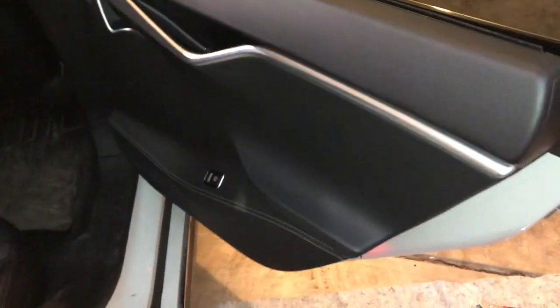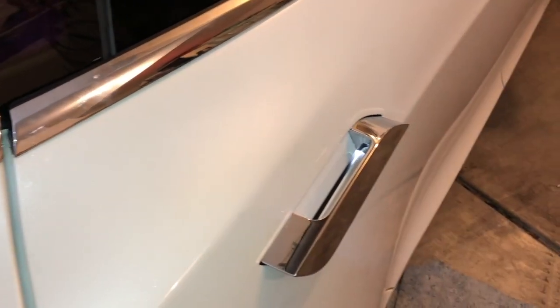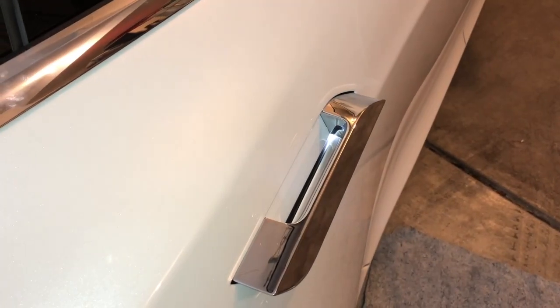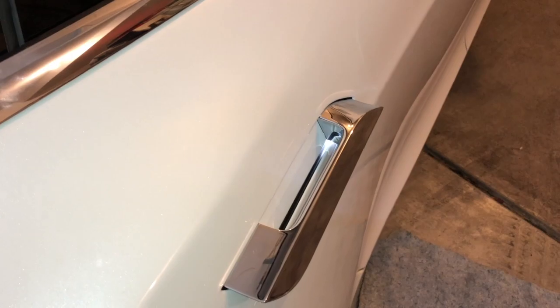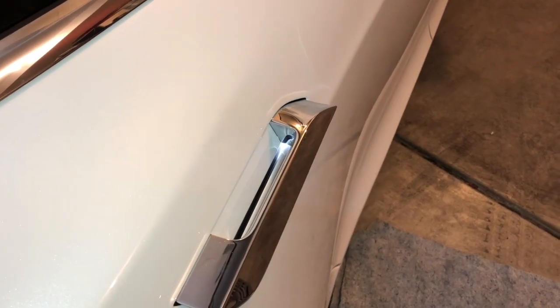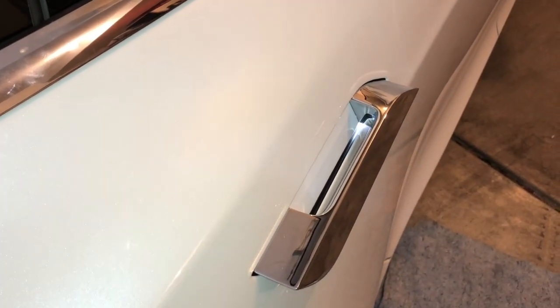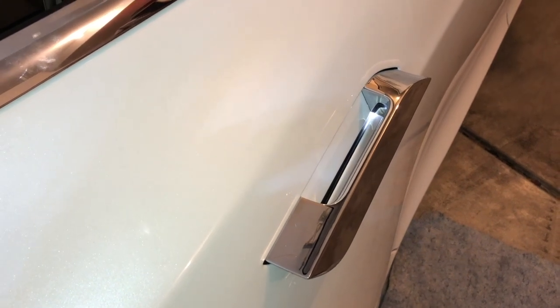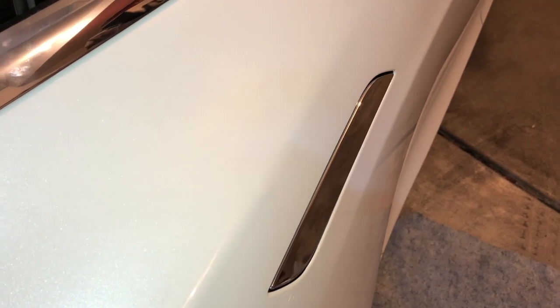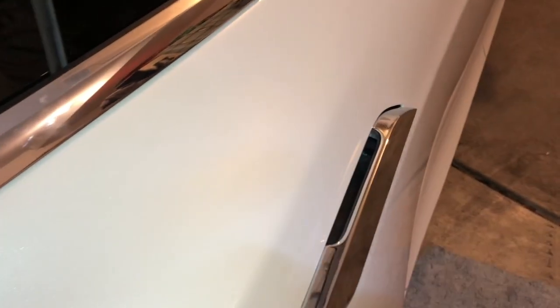And we are done. That is how you fix the little micro switch where the handle breaks and it doesn't extend out. We did that and it didn't cost a dime, just a little bit of time and we got it fixed. If you do need to order the part, you can order it from Tesla and I'll put the part number in the link. Or you can order the whole door assembly — I recommend getting that off of eBay; it's quite a bit cheaper than ordering new from Tesla. The door handle went in, we push it, it pops out and it works like it should.